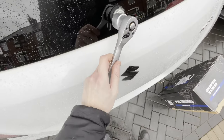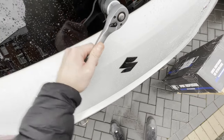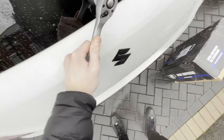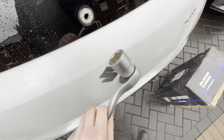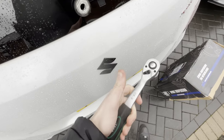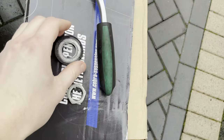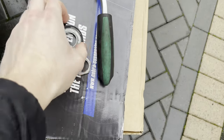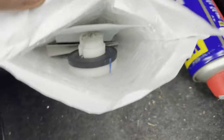So you're then going to want to take this nut off here. The size is 30mm, but as you can see it's spinning there. You need a 30mm socket on the end of a half-inch drive ratchet and it'll pop it off, absolutely no problem at all. Once you've popped that off, just hold it because it does spin. Then your nut comes separate and this falls through. And also another big white bit comes off as well, but I've put that away back in the bag now — you'll see it's that thing there.